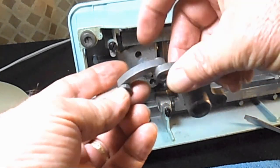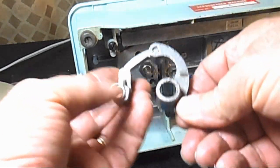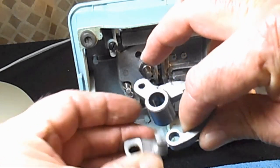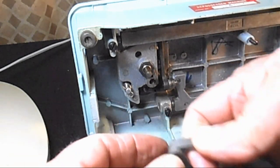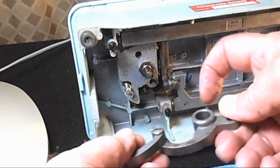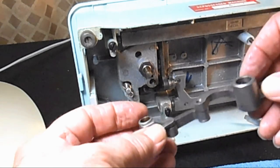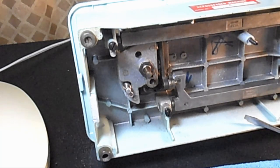This cross member here, one end is screwed in with a hinge screw into the rest of the bell crank, and the other is just a slide-on connection, like that. And they're pretty tight fits. So that's the rest of the bell crank assembly. This actually looked pretty clean here. This one looks pretty mucky, dirty inside. Nothing else is lined with that copper lining except the Pitman rod.